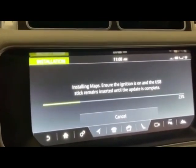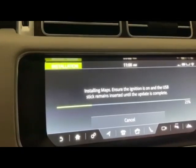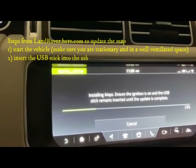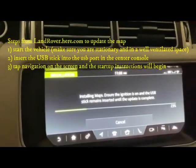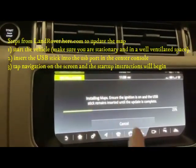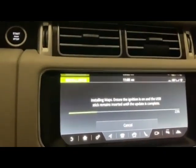It'll take quite a bit of time to download whatever map you're using — I'm obviously using the North America map. Once it's finally onto the stick, you can then come into the vehicle. You have to start the vehicle, then insert the USB stick, and then go to navigation. It'll give you startup instructions, basically asking if you want to begin — it could take up to 30 minutes — and I clicked continue, so we're in the process.